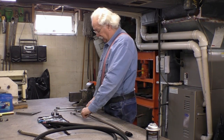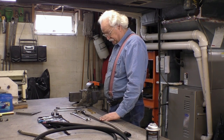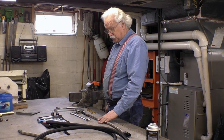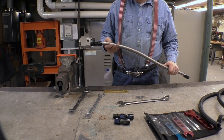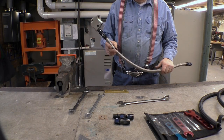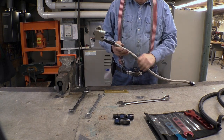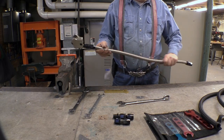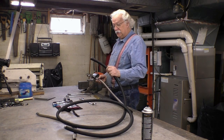I really like AN fittings and hoses for a lot of reasons. I will leave a link to the tutorial in the description below. They're reusable for one. Now a while back they only had stainless steel braided hose, and you got to be careful of the ends because they get very sharp and the stainless steel rubbing up against anything is abrasive and can actually wear holes. So I'm going to opt for cloth this time around.